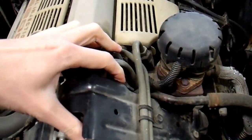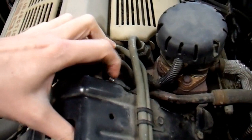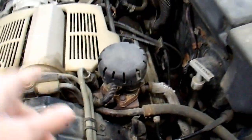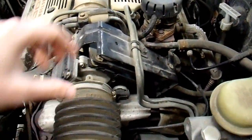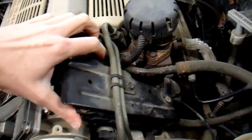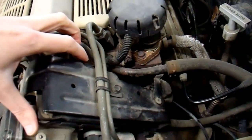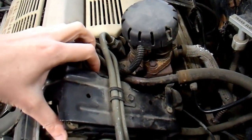And the other one is on the other side — this controls the transmission. This is just passive. Where you have this position is how far that cable is pulled out. That runs around and goes down into your transmission. This is called the throttle valve cable, and this is what you can adjust to control the shift points in your transmission.